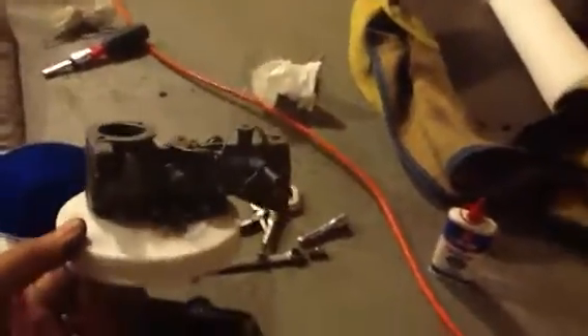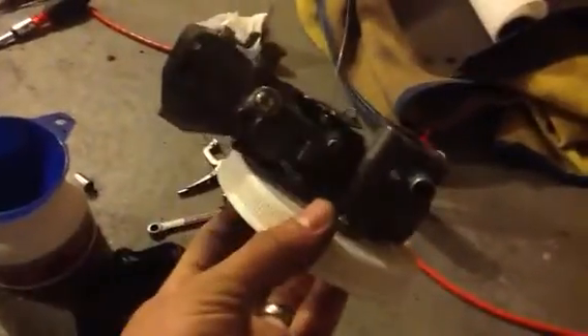So what I tried to do — I cleaned the carburetor just right here, the one that it came with. The tank was super rusted and I was having issues trying to get this thing to work because it kept getting clogged up from the rust.